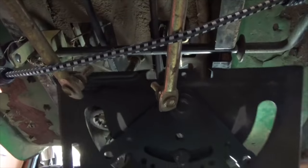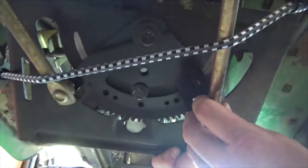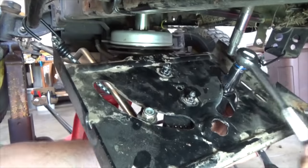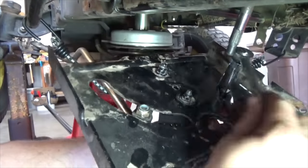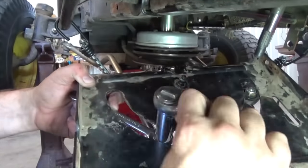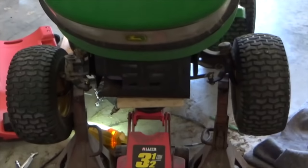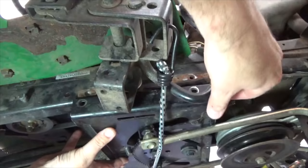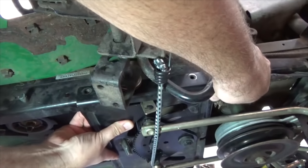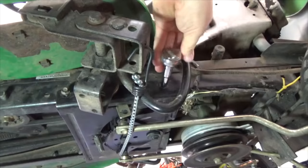Return the plate back underneath the mower. Send the drag link bolts back to the original position and tighten the nuts very well using a wrench and socket. At this point, it's important to make sure the wheels are turned in the straight position. Lift the plate back up to the frame, making sure the screw holes are aligned. Return all four screws to the plate, tightening very well.